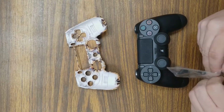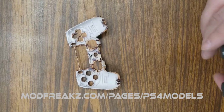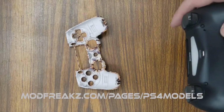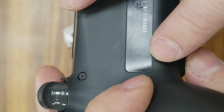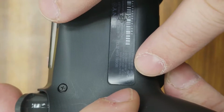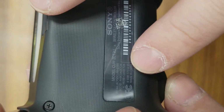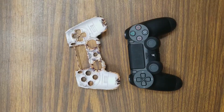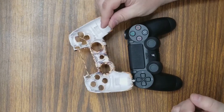To see what generation controller you have, you can actually go to modfreakz.com/pages/PS4 models. I'll provide that link in the description. You're going to look where it has made in China right here, and there's a little number right above it. With that number, you will look at their chart and figure out which generation controller you have for PlayStation, which will help you purchase the right shell.